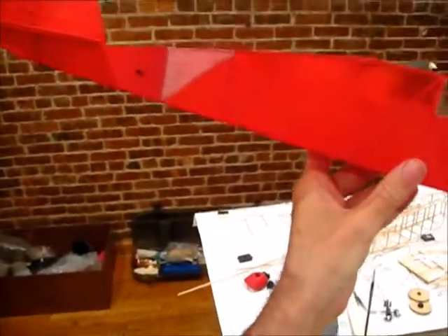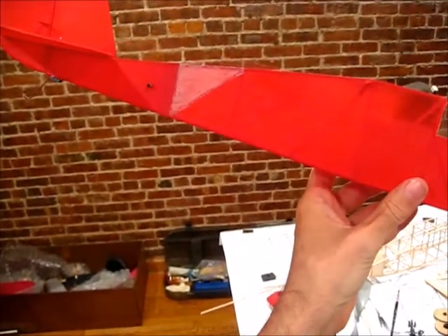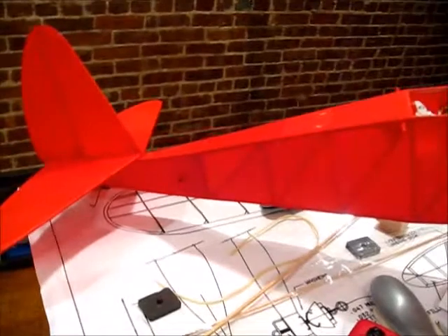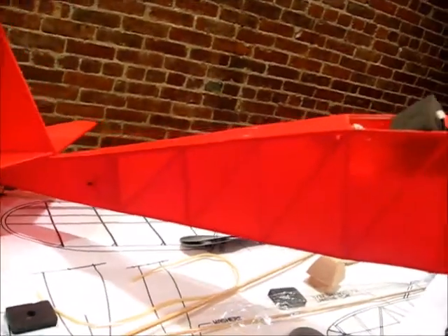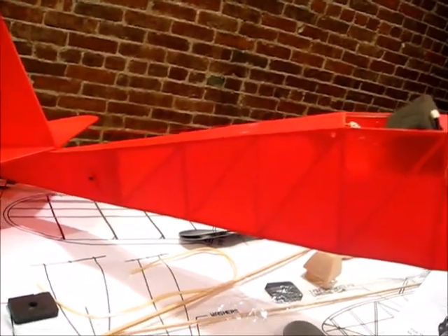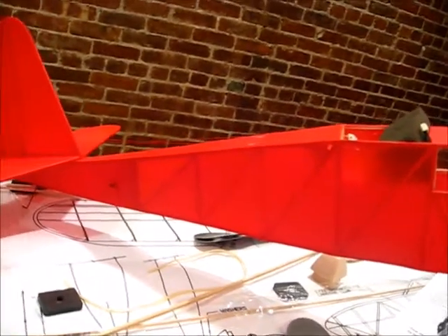You really can't even see it except there's a little glossy there. If you want, you can just spray it lightly. This is a nice way to fix tears without having to do a patch. Here's where I put the patch — you can't even see it. And here's where the puncture was. I just sprayed it lightly, and unless you look really, really close, it's not even visible. So these are two nice ways you can fix the polyspan — I only do the patch when I have to. The rest of the time I just use the glue technique, and that works really nice.